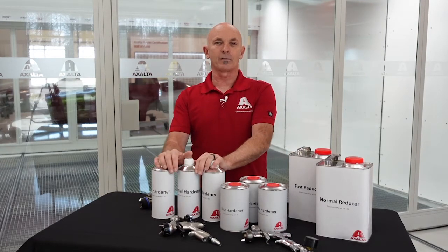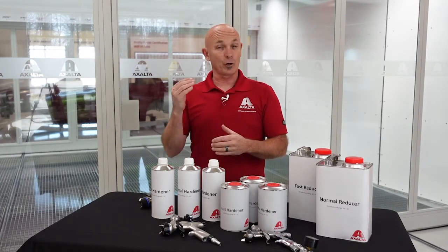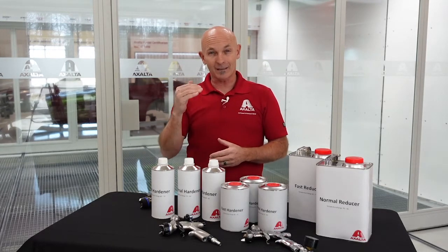All of a sudden when you deal with hardeners, we have that same booth scenario — maybe not a lot of air movement, I'm 70 degrees, I've got a normal size job, and I could use fast hardener. But if I've got a high humidity day, that humidity is going to react with the isocyanate in the hardener, and that's going to start the cross-linking process faster than anticipated. So if you're in between hardeners and there's a high humidity level in the air, always make sure you move up to the slower one.